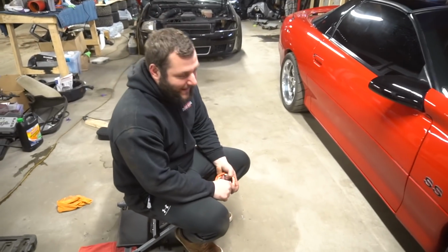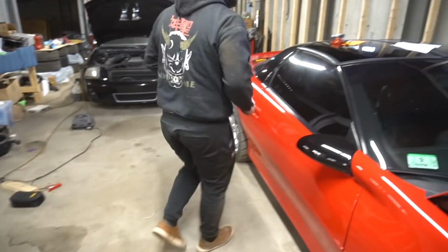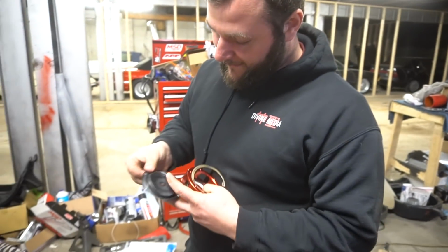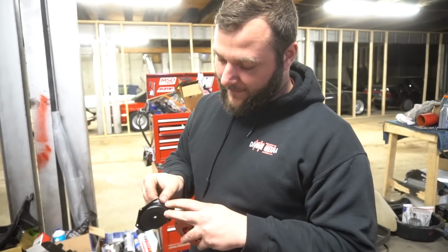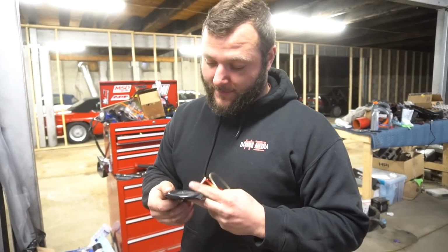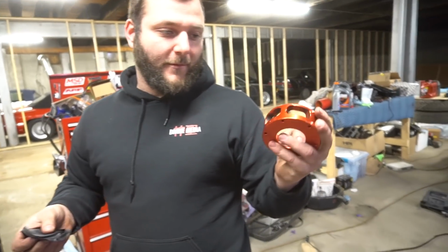and it failed on the dyno because the procharger valve diaphragm, seen here, I threw it away. No, it's right here. It was old and torn, and was releasing boost at 5,000 RPM and only built up 3 PSI. Which sucks. So I rebuilt, or almost done rebuilding it.